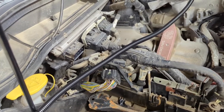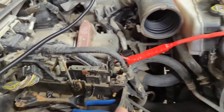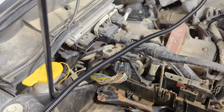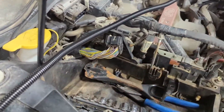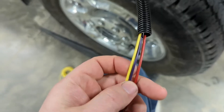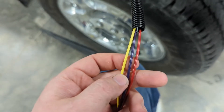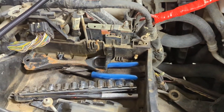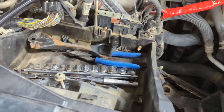It's a problematic thing, so rather than diagnosing exactly where that broke and all the fuss that goes with it, we're just going to bypass those wires. There are three wires on the alternator harness: yellow, purple, and red. The red just references the battery — you can just hook that to 12 volts, and we'll put a little fuse in there.